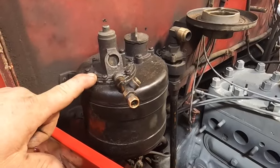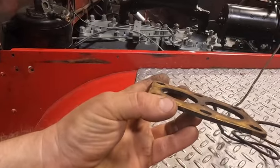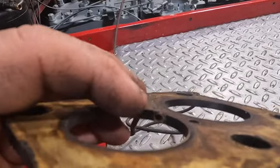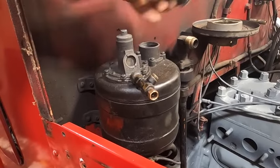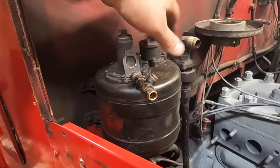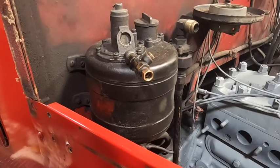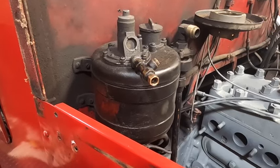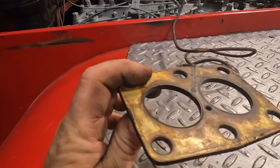There's a can with a line coming out, and a thin plate mounted between the carburetor and the intake manifold with a small hole where the tube is. You fill this up with something like Marvel Mystery Oil, which is good for upper cylinder lubrication. But all I think it does is foul spark plugs and use oil for nothing — it was used for a time period and they stopped for a reason. I'd recommend closing these off. We're going to solder up that little hole and it'll just be there for show.